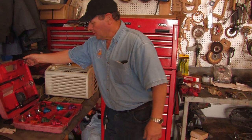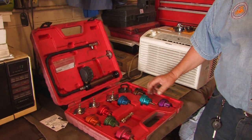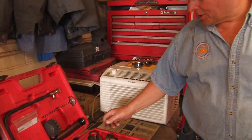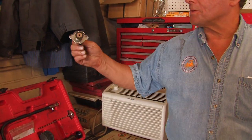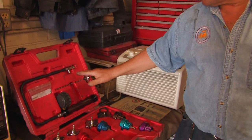You can also check the radiator pressure cap. These are all the adapters and fittings to use for a radiator pressure checker. You probably need to have one of these kits. A lot of the import vehicles — the Japanese imports — have a little tiny cap that has to fit on there, so you need to have all the right adapters for these.